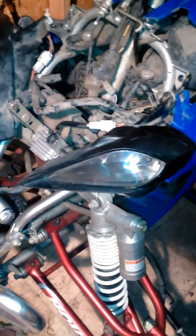This goes into this little wire right here. I did find it near impossible. Because I was changing that — you might already be wondering — yes, my headlights were blowing. I had bulbs actually melting because the rectifier wouldn't stop; basically all the power this machine makes was going through the light bulbs. It didn't last very long — about every time you did a wheelie, you'd blow the bulbs.